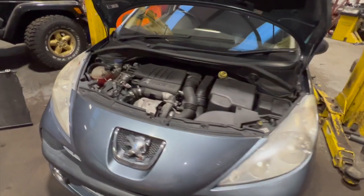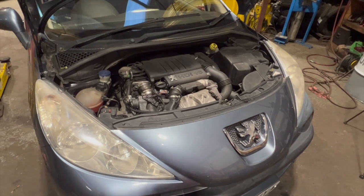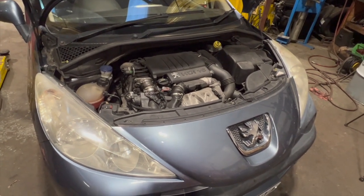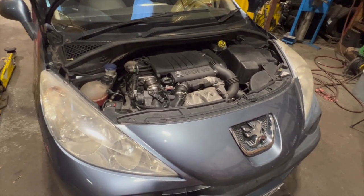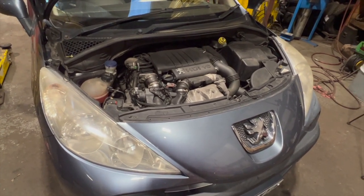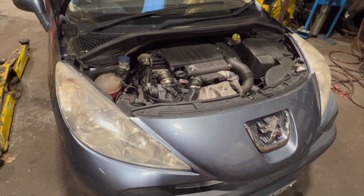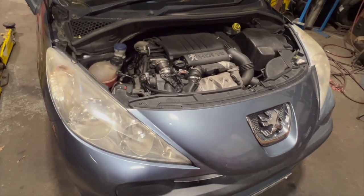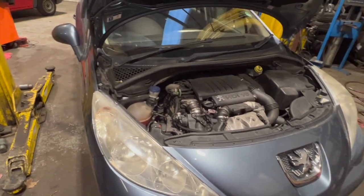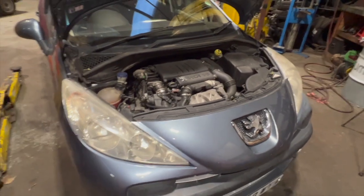That's all fully built up now and the aircon condenser has been replaced. The next thing is to simply re-gas the aircon. I've got a machine to do it myself, but if you haven't, there are self-fill kits available — though really you want to go to a proper place where they vacuum it down first. Hope you liked the video — if you did, give it a thumbs up, subscribe to the channel, thanks for watching and we'll see you next time.